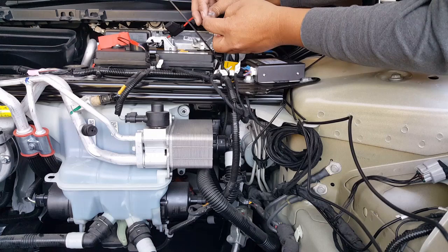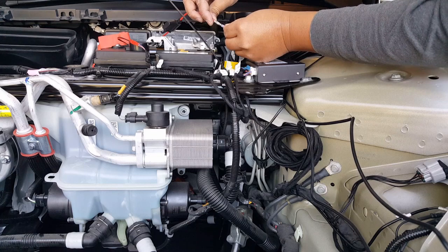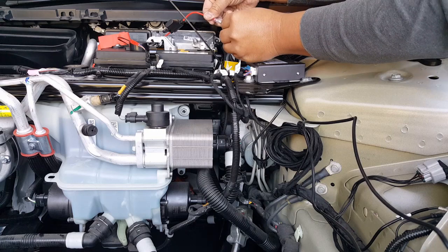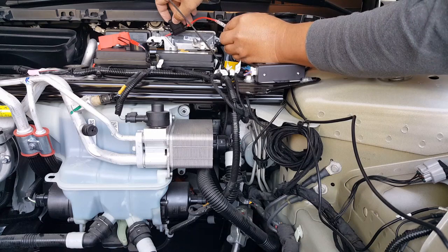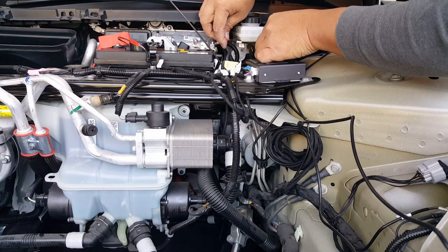Now pull the insulator back — you gotta make sure this is insulated. Because if you don't, this is the only thing protecting you from having a short. If it touches the negative wire prematurely before it makes the full circuit, it's just gonna pop that 20 amp fuse and you'll have to run to the auto parts store. Just want to make sure it's out of the way.